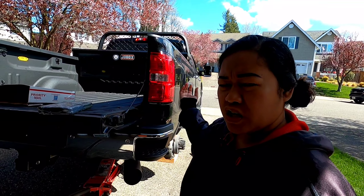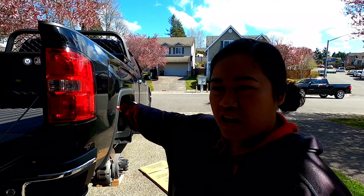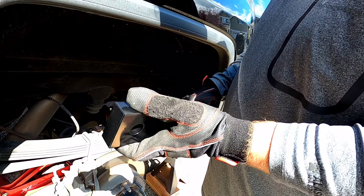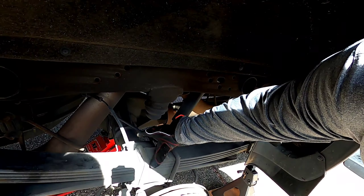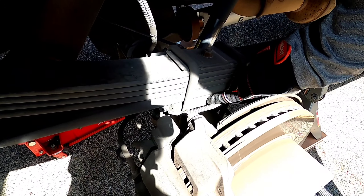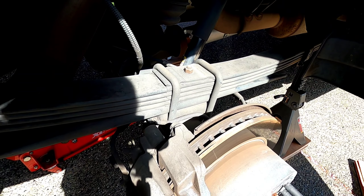So how many inches you gonna lift it? One inch. So this is the continuation of the lifting on our truck Jacob. This is not part of the suspension — this is just a lift block kit for the rear. It goes between the leaf springs, which are right here, and the axle. These two big U-bolts come off, and then it goes right in here between this piece of steel and the bottom leaf spring.